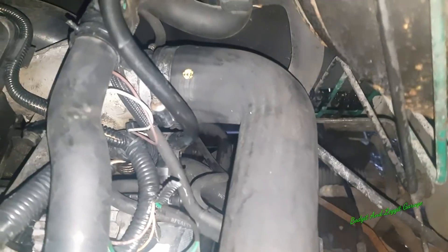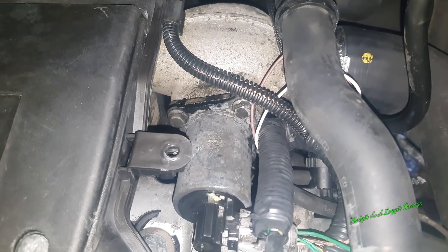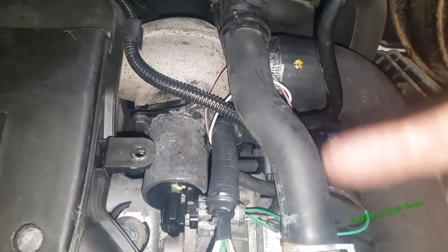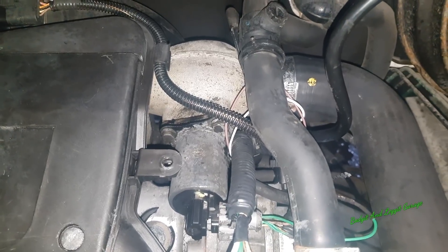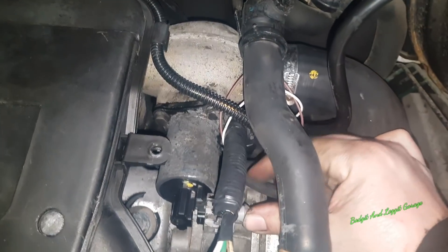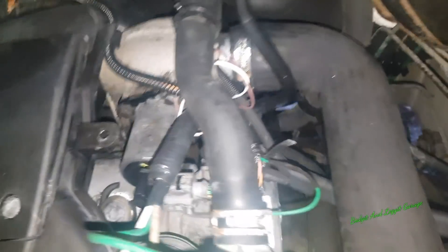We are all back together — that's our repair done. I've got to tidy up all the wires first, but you can see the oil and crap already weeping out of it as I was controlling it. It is blocked — we're going to have to take it off, clean it, or unblock it, unless the customer wants to stick a new one on. I just wanted to put it all back to see if we get anything different when we start it up — see if we get that smoke initially, see if it revs up fine. I think it's going to be better but it's just not going to be 100% until we actually clean it.